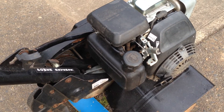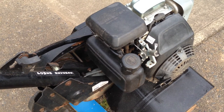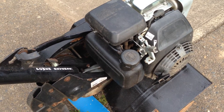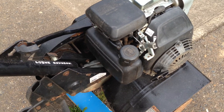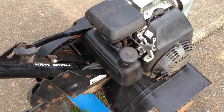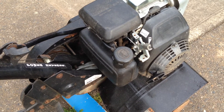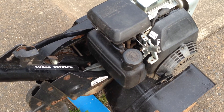I removed the fuel tank, drained it completely, flipped it upside down, and did find some debris in it. After that was cleaned out, fresh gas was put in. I used unleaded gas with Sea Foam poured in to help clean the carburetor, and still the very same issue. I also checked the fuel cap — it's allowing venting to happen, it's not plugged, and it doesn't have any junk behind the venting cap.